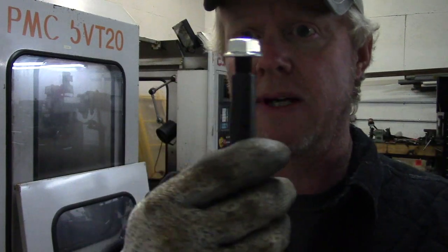They were in bad shape, but I've got brand new ones now. This video is just to show how the process goes. You determine your axle's bent - mine had about a four degree bend on the passenger side right at the spindle. That trailer was used and probably bent the whole time I had it. Uneven tire wear is usually a good indicator. The best way to get those axles off, especially if they're rusty, is a die grinder with a metal cutting blade to cut the u-bolts out.